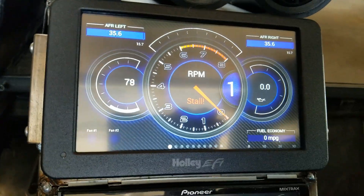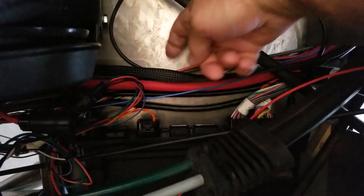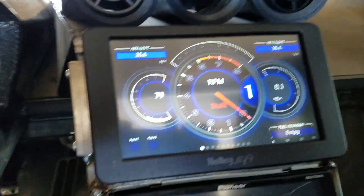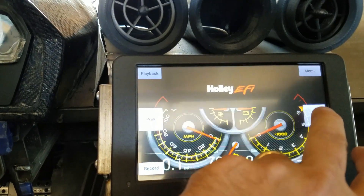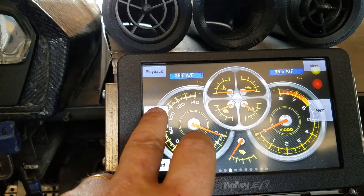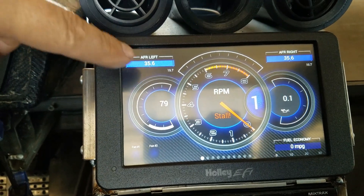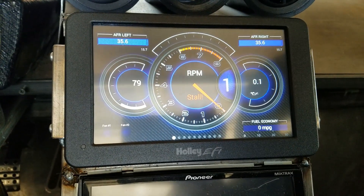This dash uses a RacePak CAN bus protocol, and then this one uses the standard Holley CAN bus protocol. We've actually upgraded our Dominator so that it has an extra plug - I think this is J3 - which is actually the second CAN bus, so that we can independently control the two CAN buses. One can be RacePak and one can be the Holley native one. The beauty about this dash is that it's infinitely configurable, so we'll have lots of different choices. We can do some custom work and put on some digital switches that will be run through the EFI ECU.